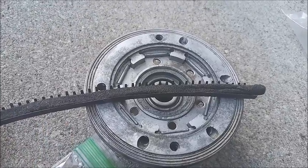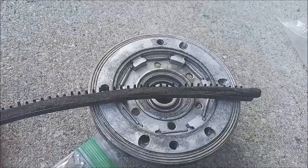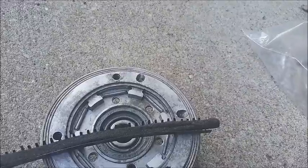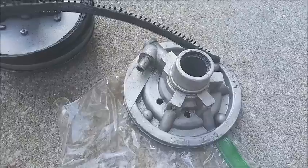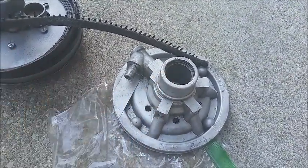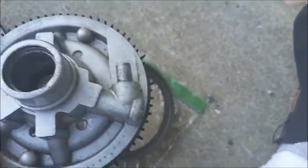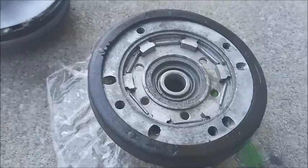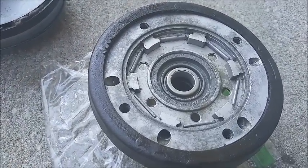Again, if it were dried out, cleaned and dried, we would dip it in new fluid. It's still soaked in fluid, so just gonna turn it the right direction and put it in the groove. Just realized that it's much easier to do with the base of the piston upside down. Then once it's in there, just lower it into the leather. And then flip it back to right side up and start building the reaction stuff.